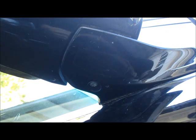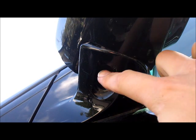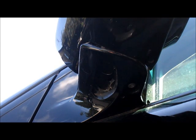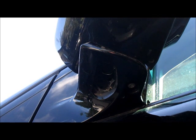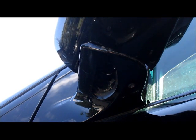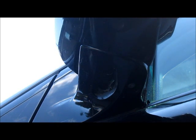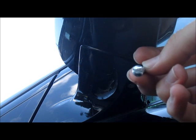That's what you do for this side. We're going to go to the other side which is completely missing the two screws. Now we're on the driver's side, which is completely missing the plastic cover and the two screws that hold the mirror assembly in place. I found that 10-32 x 1.5 inch — I'll put that in the description — was the proper size screw. I couldn't find a Torx head so I'm going to substitute that with just a standard flathead screw.